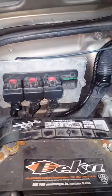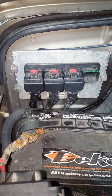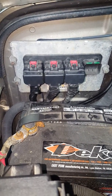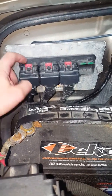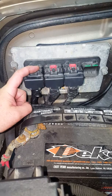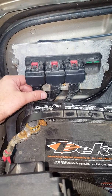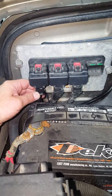And this is the main reason I'm posting this, because on this vehicle a lot of the data shows, oh, it's 38,000 pulses per mile, it's a green with white stripe, oh, it's white with orange stripe, and it's 8,000 pulses per mile. It shows connector 4, so I'm in black, and there's colors on each one, and this one doesn't have any colors, so this is the black. But as a seasoned installer, I come in here looking for a white with orange and testing, and a green with white and testing, and getting a little flustered because there's improper data information on this particular vehicle out there.